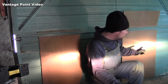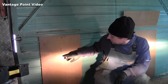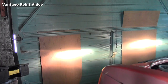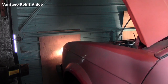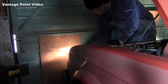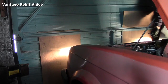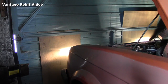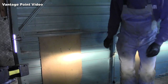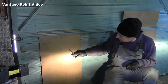They're actually quite close, but I think the round light is a little bit high, so I'm going to go through some of the procedure of setting them. The first thing to do is to push the car in and make a mark of the centre of the light on the wall — or door in this case. So that one's actually coming quite a bit below the V, and you can see that the pattern is shaped like this. So that should actually be the centre of this.